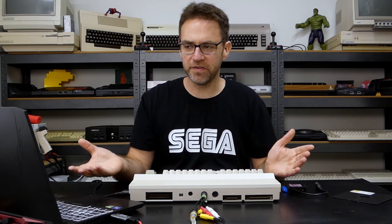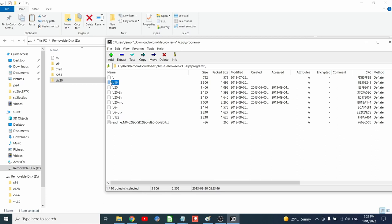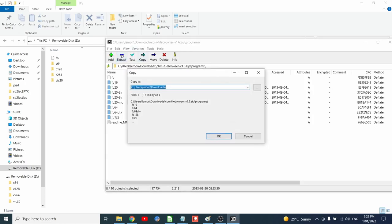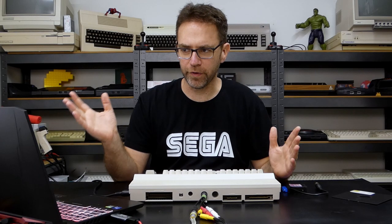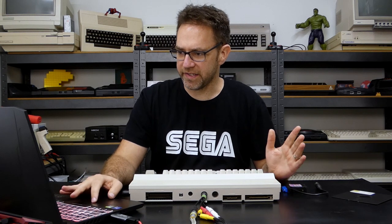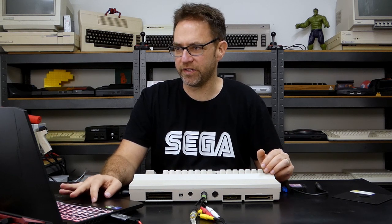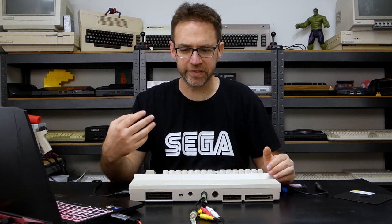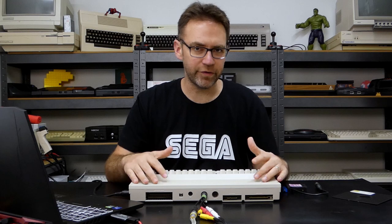Now that the folders are there, we can add files later. The next thing is to copy the rest of those file browsers to the SD card — if you only plan on using a Commodore 64, you can leave off the others. The important thing is to have that FB file first. The one I actually recommend using is called FB1K. It seems to be more compatible and a lot faster, and it has a feature called SJload which uses some Jiffy DOS routines that speeds up loading even on a stock C64.